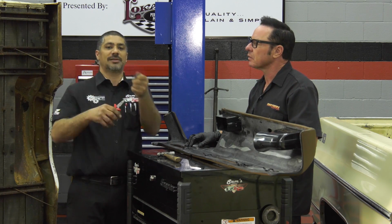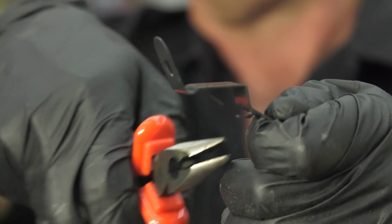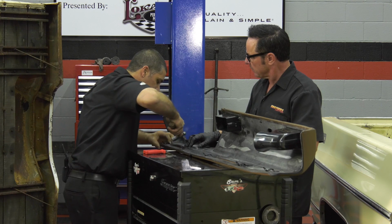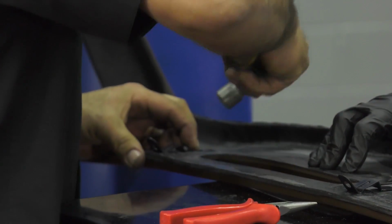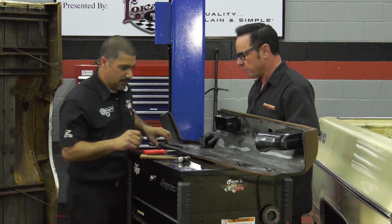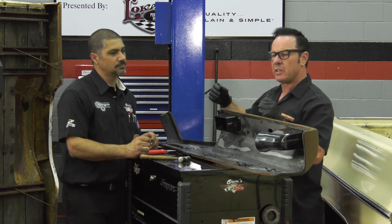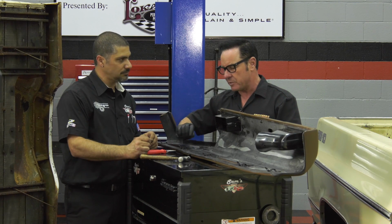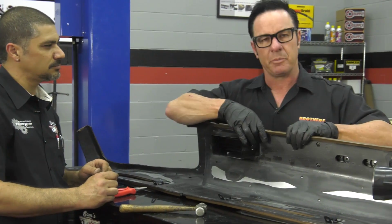This thing's got a little tab right there. We bend it out, and then it's got a little area where it goes in onto the dashboard. You put it into that hole, and then I can take a little hammer and tap it just a little bit, just like that. That puts me right here in this slot. Clicks right in place, just right in this little recess. Yep. And then some of the other stuff, like Sam mentioned, don't be afraid to get out your razor blade if necessary and trim back. Some of this urethane gets thick in spots, and it might hold you up from putting in your clips or even some of your speed nuts back here.